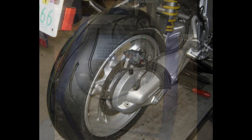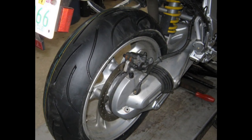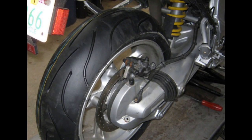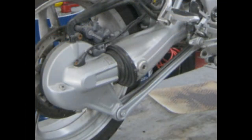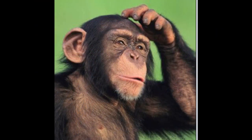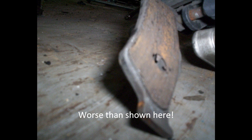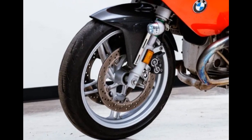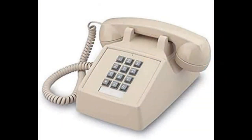But I look at the rear brake, and I look at the odometer again, and I look at the rear brakes again, and I look at the other side of the brake disc, and I look at the caliper, and I take the caliper off, and I scratch my head. There's no brake pad material left. This rear disc is scored. This thing is metal to metal. The fronts don't have any wear at all — looks like they haven't even been used. So I call the customer.